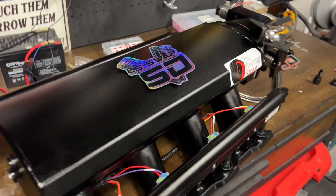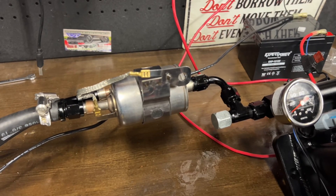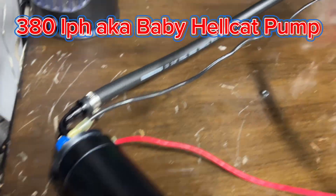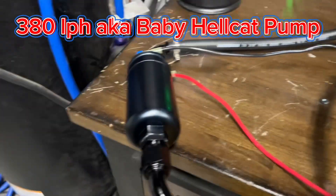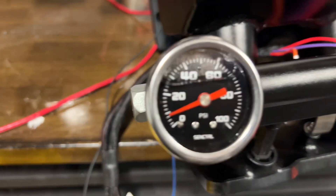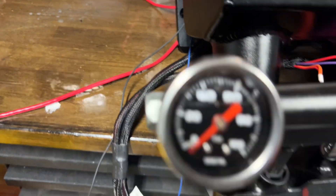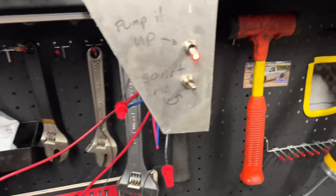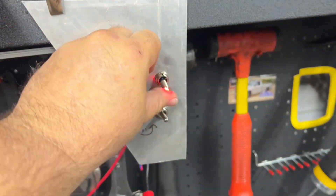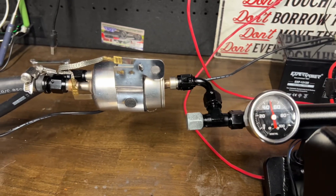There you go — that spray is just perfect. So now I'm going to show you why this can go wrong. We have our fuel filter regulator hooked up, but now we're using this big fuel pump that's supposed to flow 380 liters per hour. What do you think is going to happen when that big fuel pump tries to stuff its flow into this little fuel filter? Let's crank it up and see. The pressure spins way past the gauge — this thing is producing enormous pressure. Look at that gauge spin around. Let's run the injectors just for comparison. That thing's basically converted to a pressure washer. So who would have thought putting a big fuel pump on a little regulator would jack up the pressure like that? Let's go ahead and turn this off.